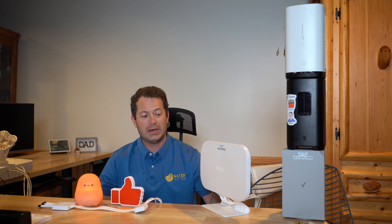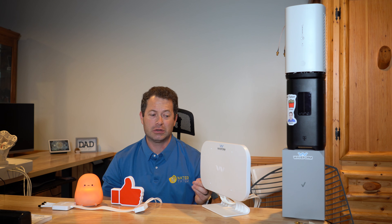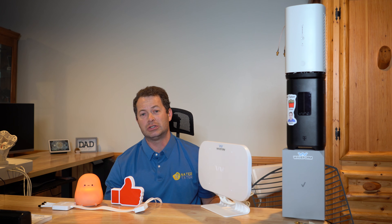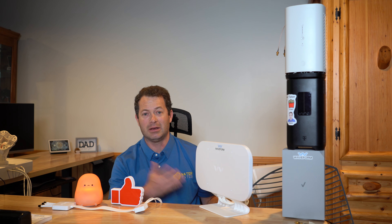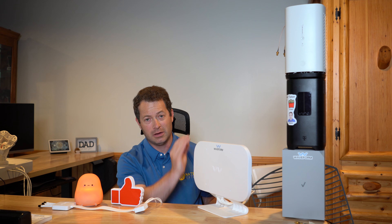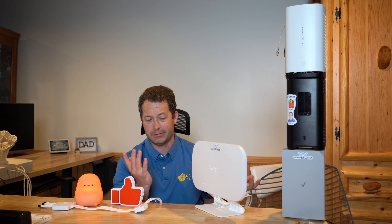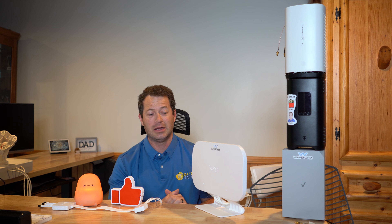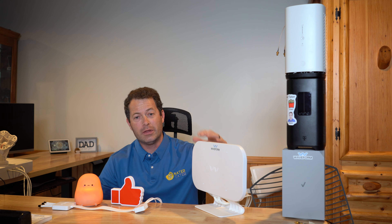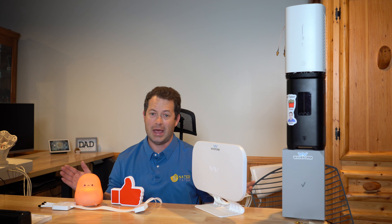The Quad Mini is their smallest and most affordable one. It's a great all-around antenna for just improving your signal. It's also great if you want your gateway somewhere in your house — inside, in a different room, up higher on a shelf. This will allow you to do that. It will get better signal than the gateway itself, but it's not going to be as drastic a change as the bigger ones. If you put it outside, it will help a lot. It's omnidirectional, which means it picks up towers from anywhere — you do not have to aim it.